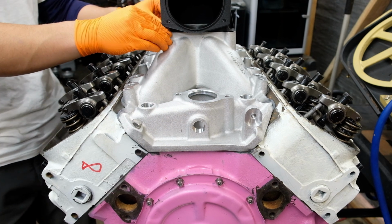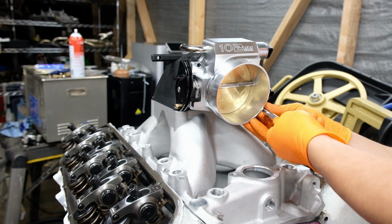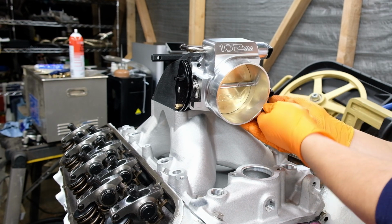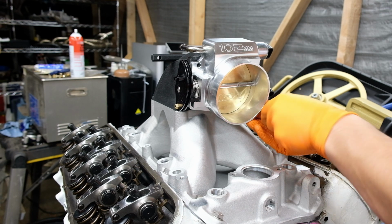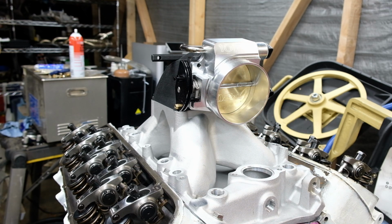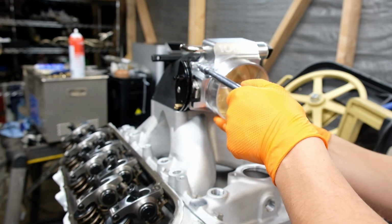Then goes on the intake elbow I 3D printed out of almost solid PETCF that is heat proof to over 300 degrees. It does a 100 degree turn from the Dominator flange to an LS style throttle body, and it uses an O-ring to seal. It's roughly equivalent in strength to a cast low grade of aluminum and weighs less than half as much. I just have to hope that it's strong enough to handle boost.